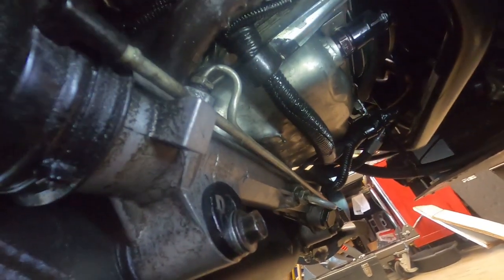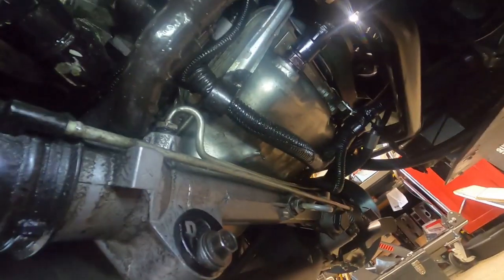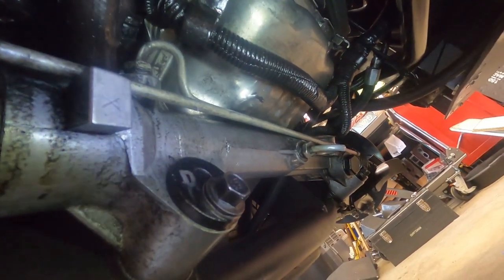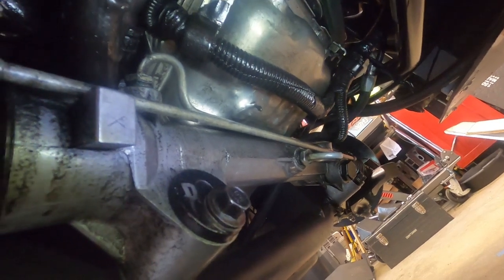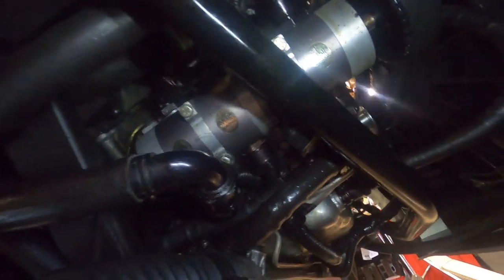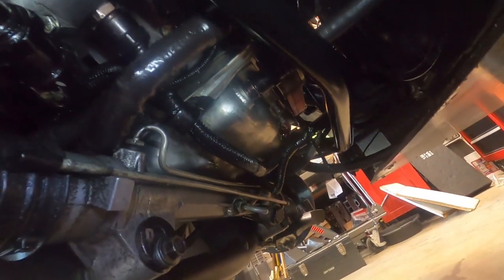Front of the engine looks pretty good. No obvious breaks aside, but the obvious culprit is right there. That is the bottom of the oil pan, and you can see it's dripping right there. Looks like piston 1 decided to exit stage left. We'll have to tear the engine apart, see how much damage is there. The block externally seems to be together, but God knows how much damage is internal.